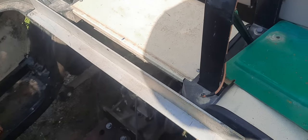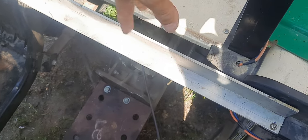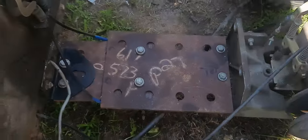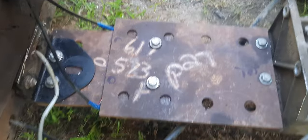It's all very solid and sturdy. I also had to add a piece of channel aluminum to the back to give it some support, because for some reason when they designed this golf cart this whole back end was all open. So I put that in there with two bolts on each end and bolted it to the tubular frame.